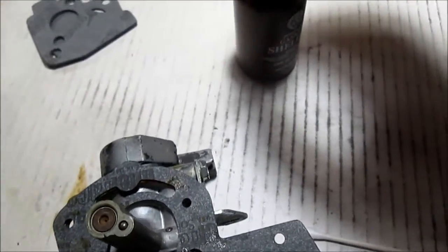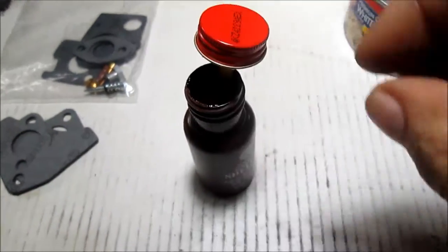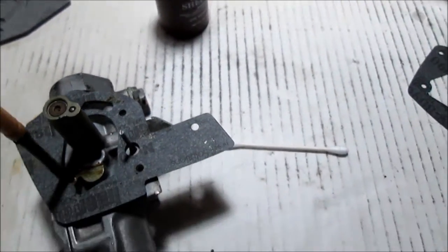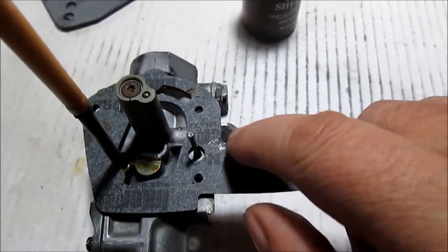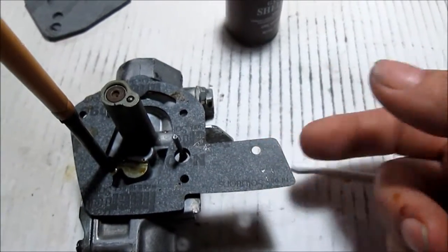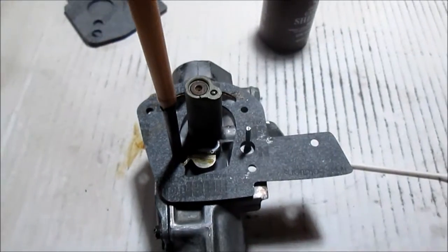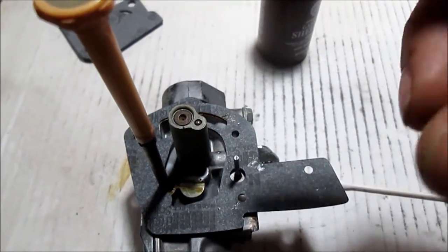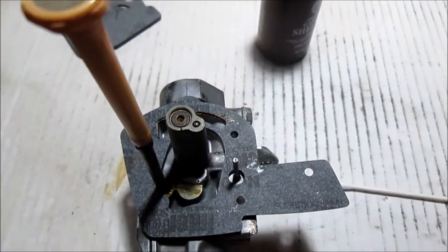Okay, we got the gasket stuck. Like I said, if you can see, this stuff is runny, and we just used the Q-tip. We'll have a photo at the end there. This is all glued and sticky. Well, this is for a bracket. This extra, you'll see later, there's a bracket. So that's stuck there. It's not going to move. It'll help seal it. We're going to get it on the tank and get the screws in it. If we're going to take a screw back out for a bracket or something like a breather tube, we're going to get all the screws and get that sealed down to the tank.